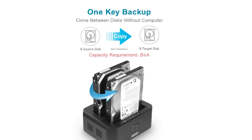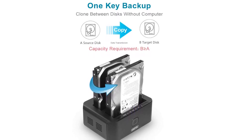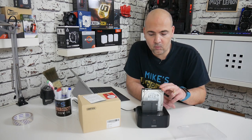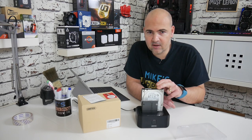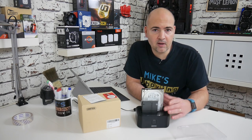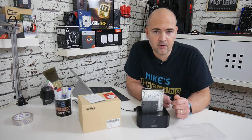The only disclaimer with cloning is the source drive must be smaller than the destination — for obvious reasons you can't copy a larger drive to a smaller size. If you've got a one or two terabyte hard disk drive but only about 150 gigabytes of data, and you want to clone to a smaller SSD, you can connect this up to something like Macrium or EaseUS software within Windows. Use the caddy in that fashion and it will manually resize the folders, directories, and partitions accordingly.